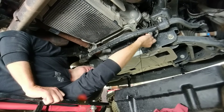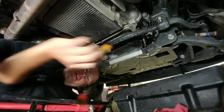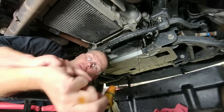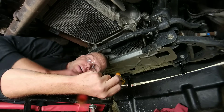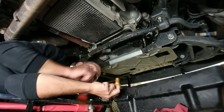That's drained down enough to actually remove the oil plug altogether. Look at that funky thing — it's got a little O-ring in there, which is one of the tricky parts about getting it to release. If that O-ring is kind of seized in there, it'll make it hard to pull out, and then when you do pull it out, all your oil comes out spraying all over the place.